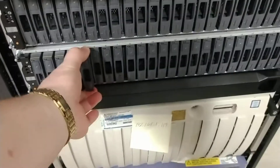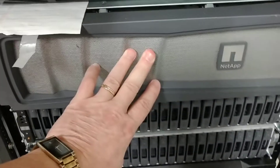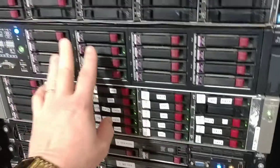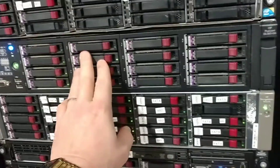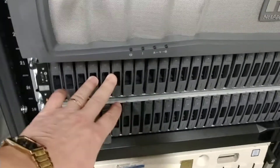This chassis actually allows you to connect it to other devices instead of a NetApp device. The key detail here is, for instance, I want to connect this up to my HP DL385G6 with a SAS controller interface. But since it has a mini SAS interface and we've got a SAS chassis here, we have to have a specialized chassis interface cable known as a SAS Mini to SAS.